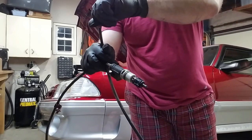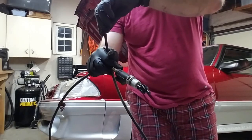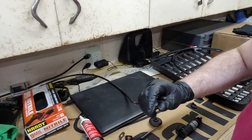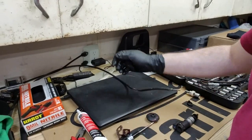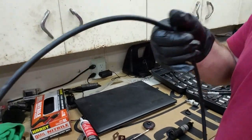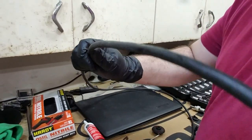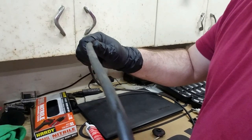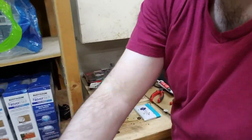It turns, but it does feel like there's a little bit of tension in there. The old cable is pretty much junk. I noticed when I was feeding this through it is kind of binding up in here — it's seen better days. I believe this is the original one. You can find some flat spots, and it's getting a little too close for comfort near some warm parts there. We'll go ahead and set that one to the side because we no longer need it.